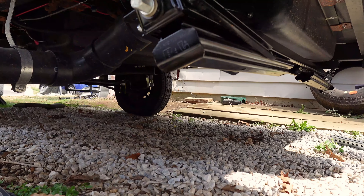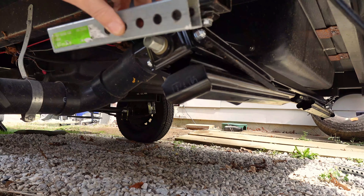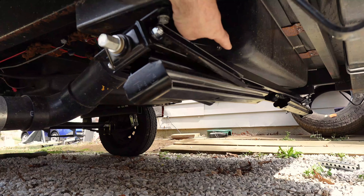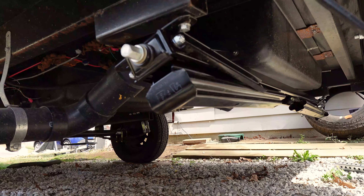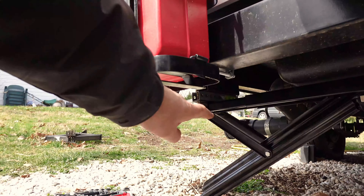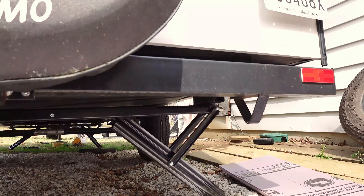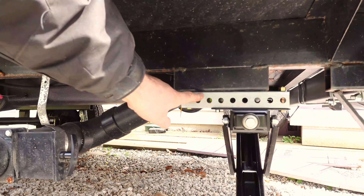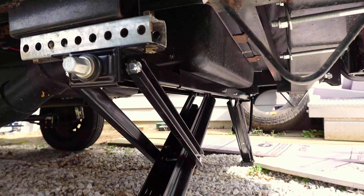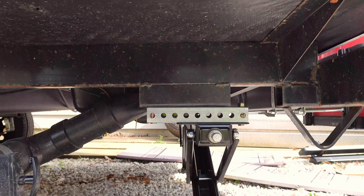The rear is not going to be as easy, at least on my travel trailer. I'm going to be putting this right in between here — it'll bolt up to the original holes, and this will bolt right up to it. It'll drop it an inch and a half, which will give me plenty of clearance for my black tank. This is probably one of the easiest things I've ever installed on the RV — just a cross brace. You can see the C-channeling there. So it completely eliminates side sway. I had to make a little piece I got at Home Depot, cut to length — that fills up the gap so it's not touching my black tank. That wasn't hard at all. Now let's go inside and do a shake test.